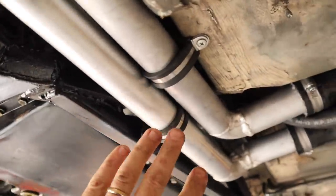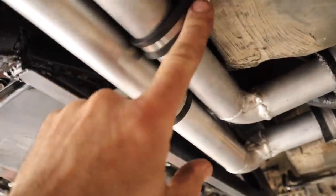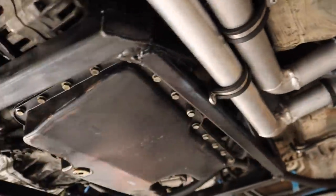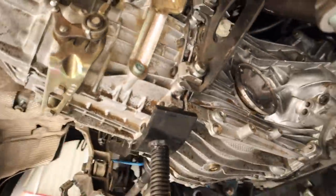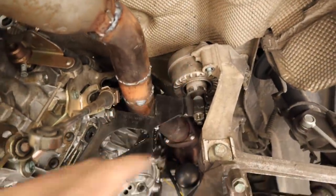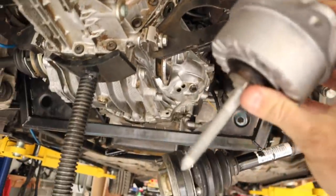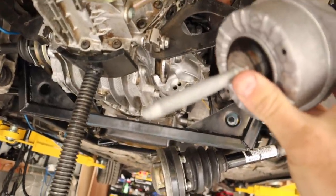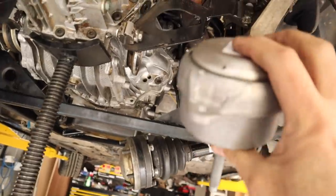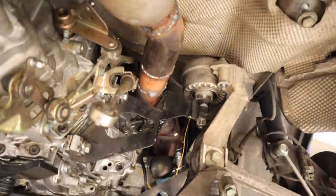We have our aluminium pipes — they're separated and protected by these P-clips, just with some self-tappers, which are plenty fine for this car. Everything's done back up again. Moving back, I've supported the gearbox because I'm going to change over the gearbox mounts. I actually have a couple of these engine mounts for the 996 that I was going to put in, but I think they're going to be better served in this car replacing these ones, which are completely shot.